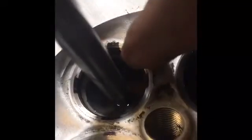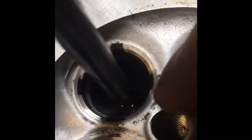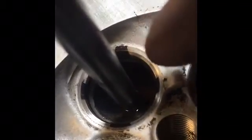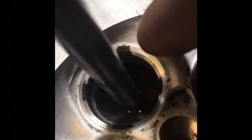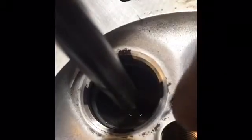And if you look right here, this is what we want to see. So you see how there's still a lot of black right there? So that's not grinding. So that is what we'll call a low spot that we need to go over to make sure that this surface is uniform. So we'll go over that and get that black spot removed so that it actually is an even 30-degree surface all the way around.